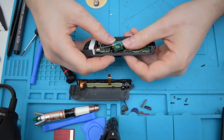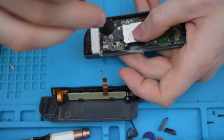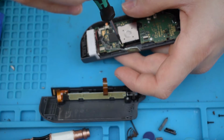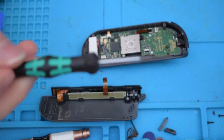I'll leave that for a second. Put the screws back in, plug it in, put the battery connector back on, and that's done. Remember, go counterclockwise at first until you feel the thread, then tighten it up. What I'm going to do is not tighten it up all the way until I've got the other screw back in.